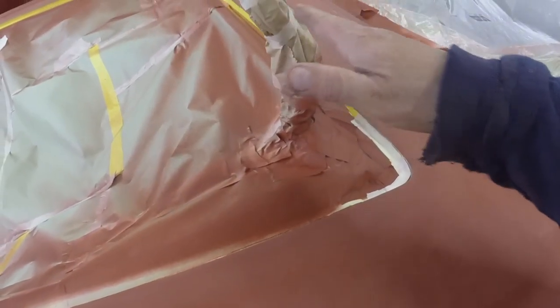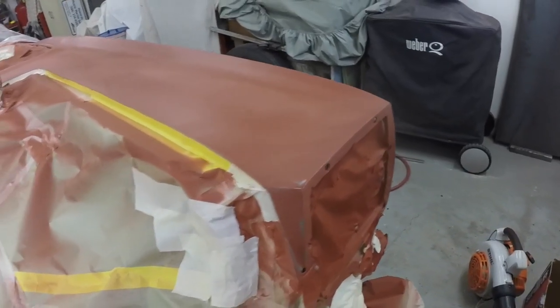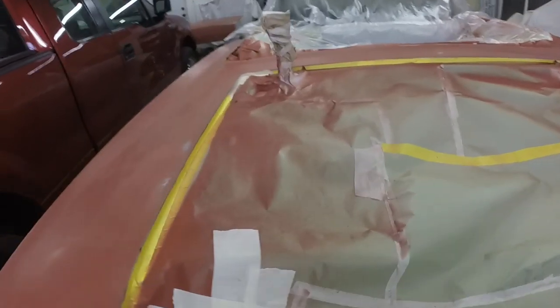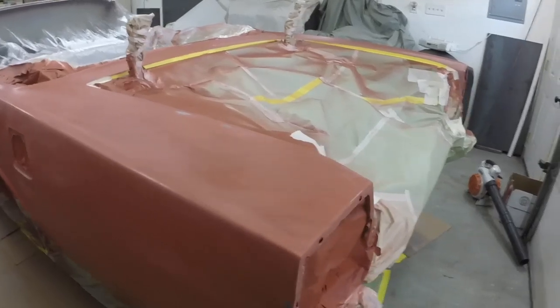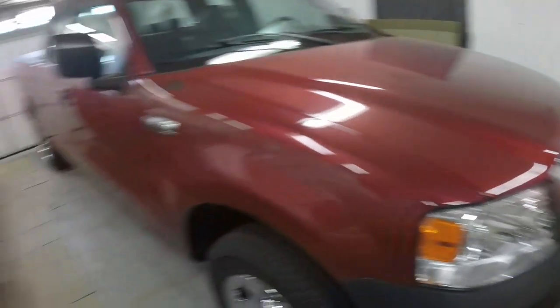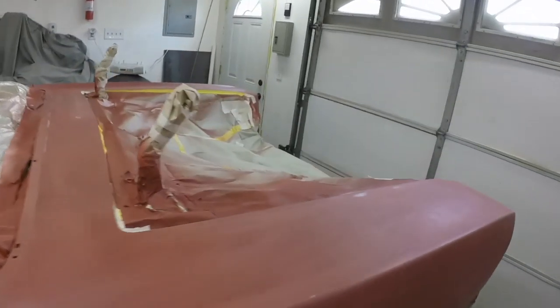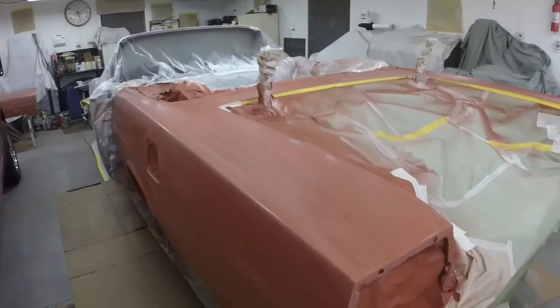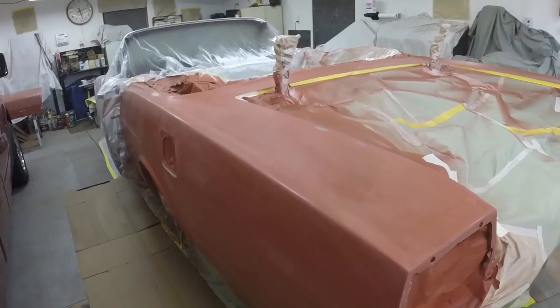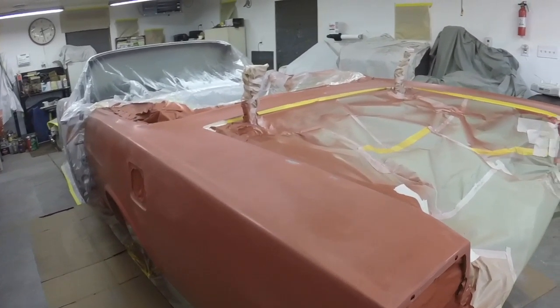All this tape is peeled back enough so I don't get a sharp edge. I had to cut holes to re-stick this because when I blew it off, I blew those in. I'm blowing on 125 psi of air to blow it off and I'm spraying with 25 psi — it's not gonna be blowing stuff everywhere when I'm painting. But the trunk lid are both wiped down and ready to spray. I'd rather paint on a cooler day than on a windy day, because I can wait a little longer between coats. But if I get spruce needles or dirt or dust from high winds, yeah, that stuff will stick in the paint and make a mess.